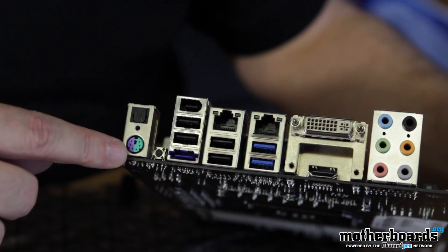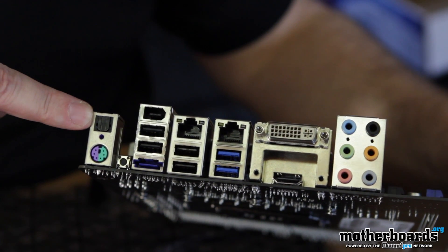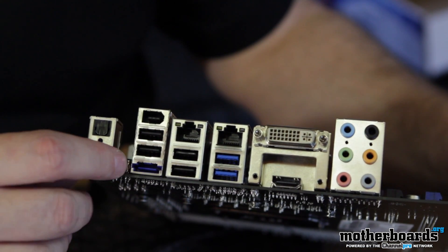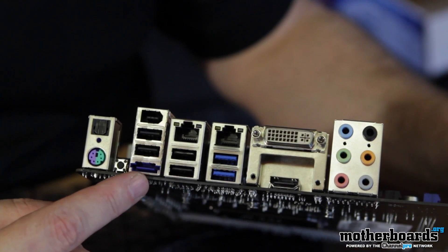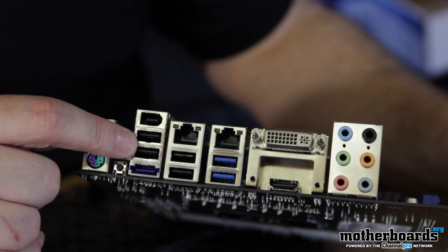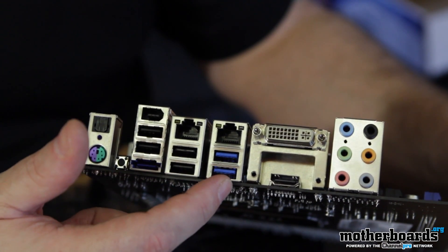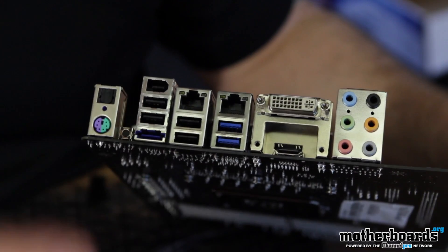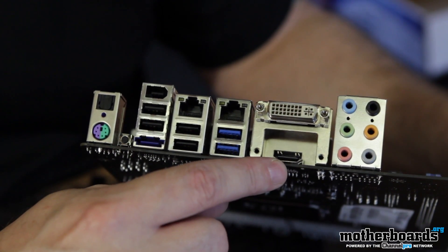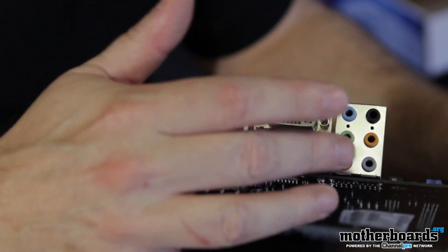So here we're going to take a look at your rear I/O. We see that we have a combination PS2 keyboard port here — this is good for people who want to use those old school peripherals. We have the optical audio, for all those people who use digital speakers — a really good feature right here. We have a little button right here for resetting your motherboard, really cool for overclockers who don't want to get into their motherboard to mess with things. We have the external eSATA port; above that we have two USB ports; then we have the IEEE FireWire port; we have two more standard USB ports; over here we have two USB 3.0 ports; and above those are your two RJ45 ports for your internet connection. One thing really cool about this motherboard: it's a fully fleshed-out Z68 motherboard — it does provide an HDMI port for video, which is really cool, and a DVI port. And for those of you who want to use your audio old school, you have the 7.1 analog inputs right here. So a very fleshed-out rear I/O.